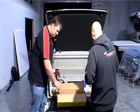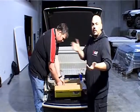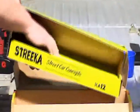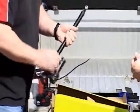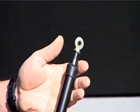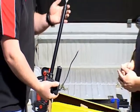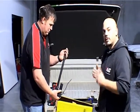The kit comes with two brackets, one for each side. Because they are a multi-purpose kit, you can fit them into basically any kind of vehicle. Do all your measurements — we'll show you what measurements you need. This is where the magic happens: a 12-inch linear actuator. These things lift 100 kilos each — plenty of grunt to lift the tonneau cover, no problem at all. They've got a little ball joint in there so you can swivel around a bit. The way you mount these is off the bracket connected to the top of the tonneau kit, and that will push it up out of the way.